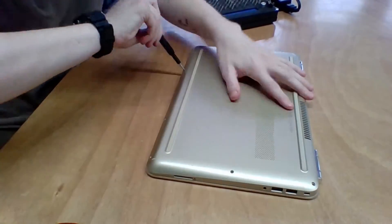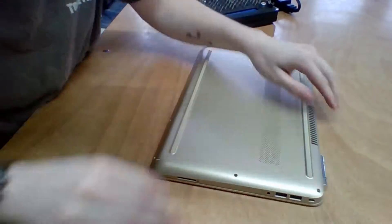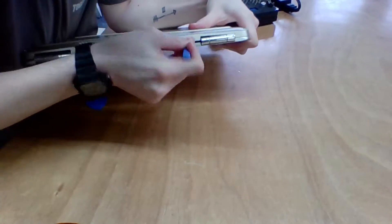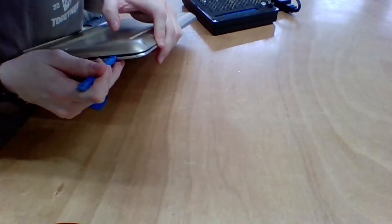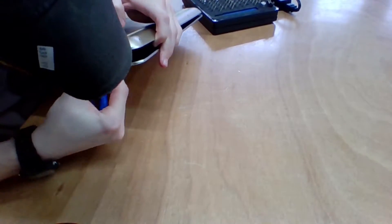If you see me struggling with taking the bottom cover off, just confirm that the screws under the feet are unscrewed and fully out — sometimes they hide them under the little rubber feet. Once you confirm the screw is out, you can use a spudger and go along the casing. You may break clips just due to the fact that these laptops are ungodly junk. Make sure you have all screws out and then use the spudger tool to get all the clips out, and then you can replace the hard drive.